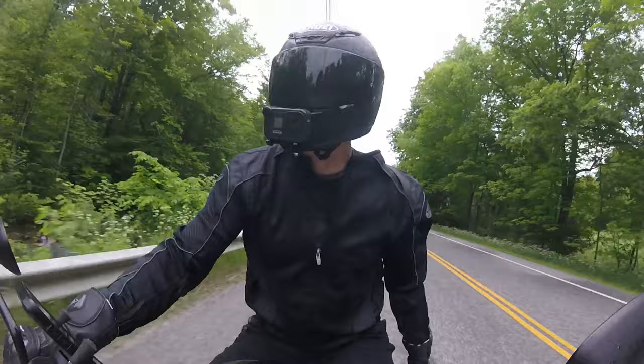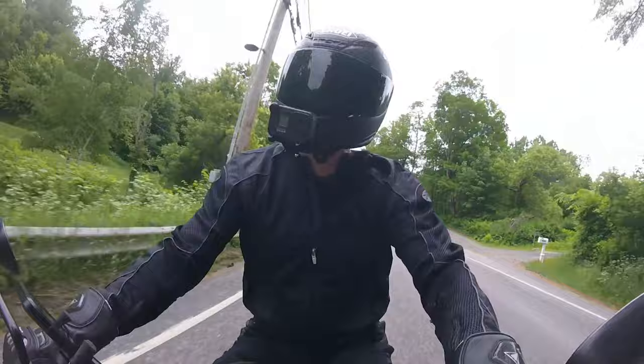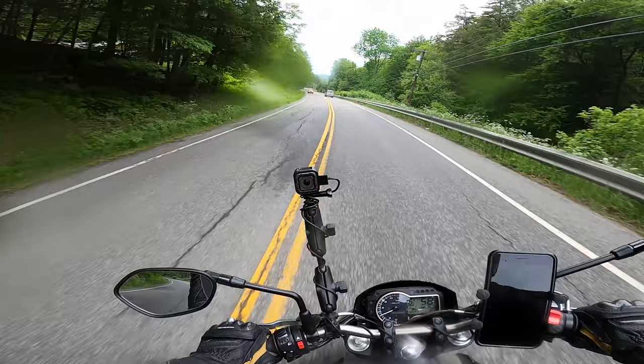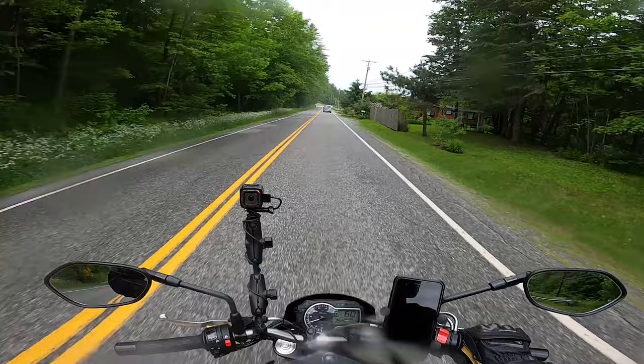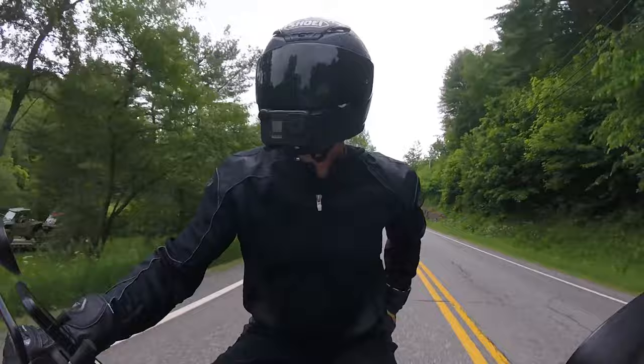So that even at idle, once I get idle set, I start turning individual ones so that at 4,000 RPM, it's perfectly flat across the top. You want the same exact vacuum pressure on each cylinder, each throttle body, at that specific speed. So at 4,000 RPM, it should be perfectly aligned. And when I drop down to idle, number one might be higher than number four. One and three, two and four usually are similar. Anyways, it's different probably for every bike.